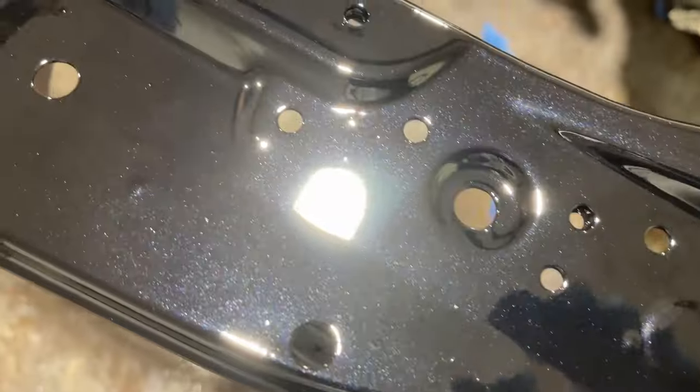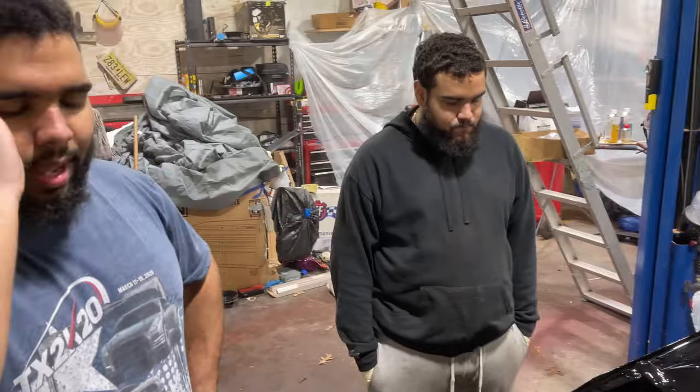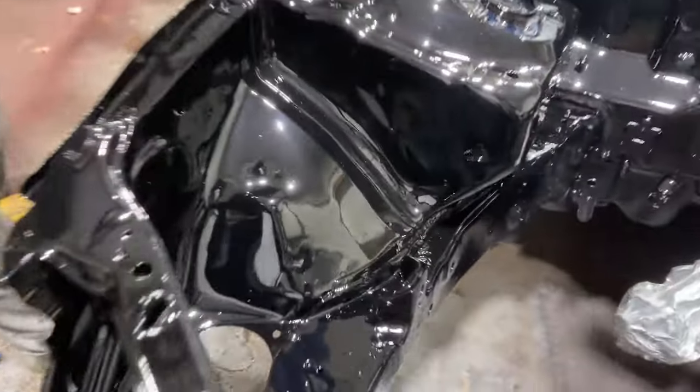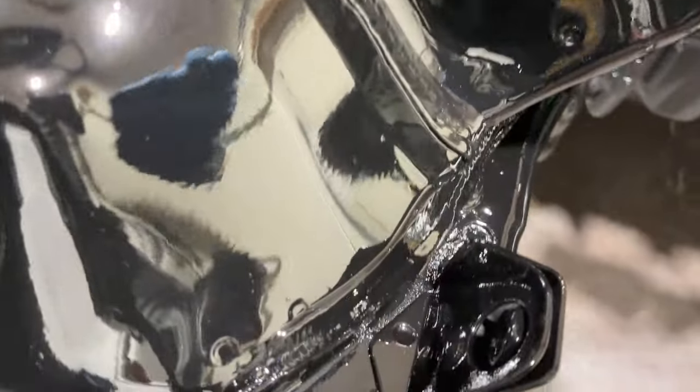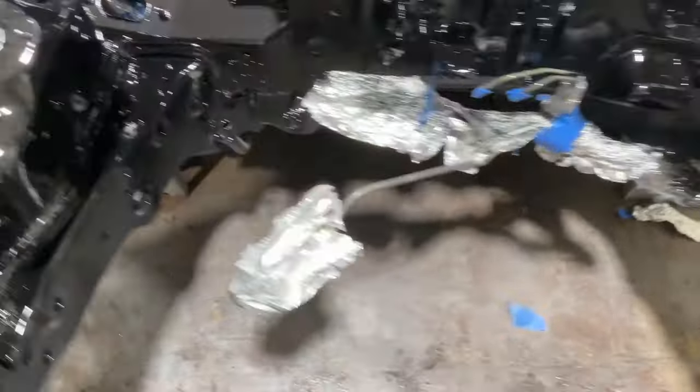I'd say this is our best thing yet. The NRS is pretty good, but that didn't have any metallics. The metallics weren't really a problem. With silver you just get tiger stripes — you got to be careful. I just painted parts for a car and was able to avoid the tiger stripes, but it is a little harder to paint. That's a complete mirror right there. This is absolutely great. A little bit of orange peel, but this is a race car, so if it wasn't, you could wet sand and buff the faces to get a better finish. This one does have a bit of orange peel, but on the tops we killed it.